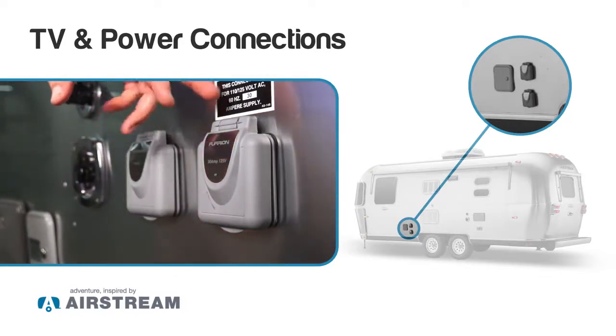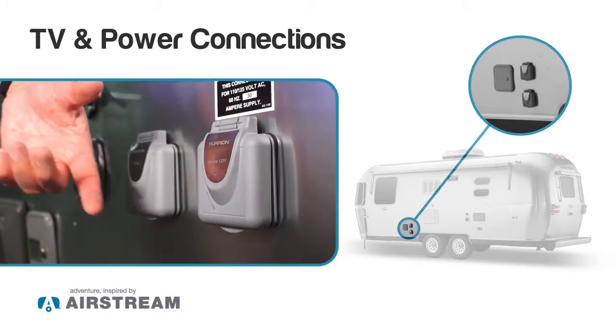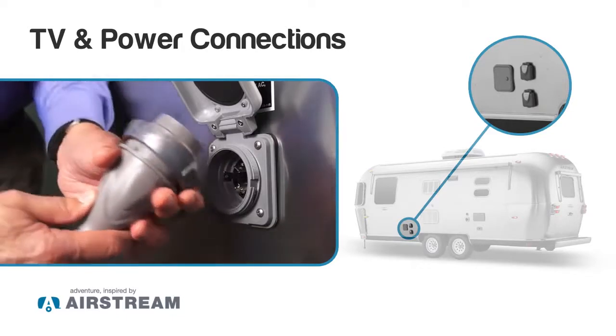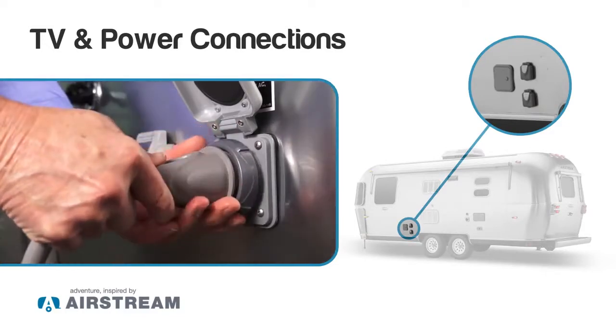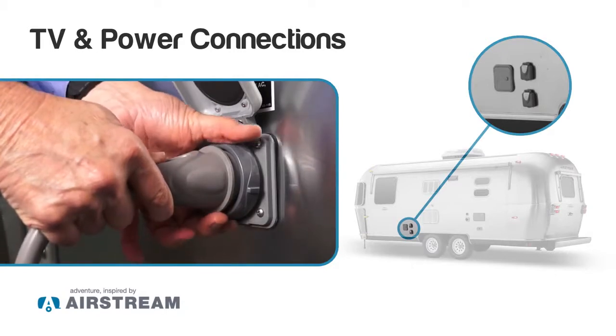Next we have the 110 hookup. It's a 30 amp hookup, shore power cord. We have the cord, it's a twist lock. You just look at the ends on there, line them up with the prongs on the inside, then you'll twist, and then you screw the little collar on there to hold it securely in place.